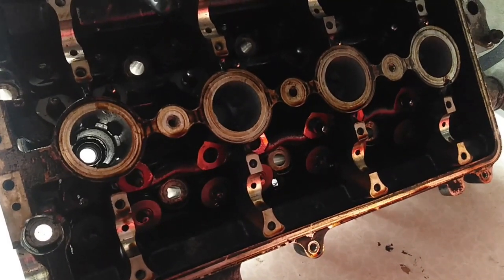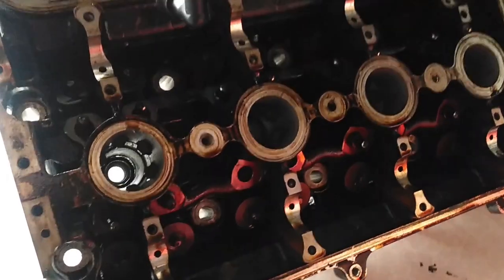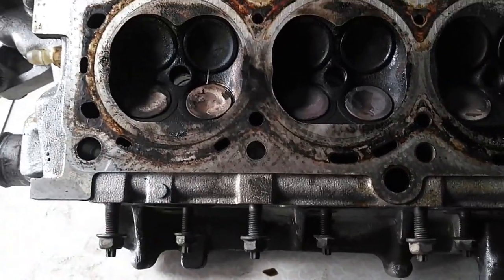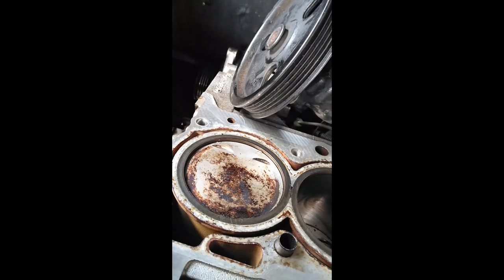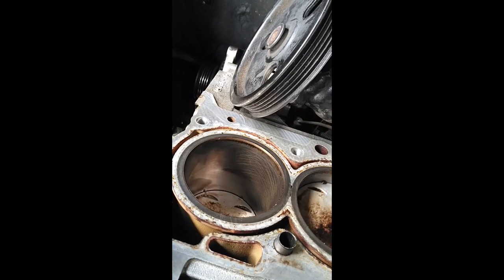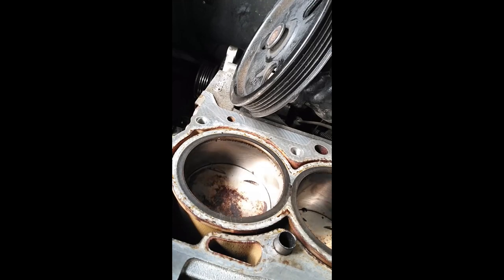Good news is I think we're gonna be okay. The old head gasket had that totally decrepit and rotted-out look basically to it. The head itself — the cams didn't look brightly polished. I think we're gonna be okay. These valves — I'm probably just gonna leave them in the car. I'll clean them up of course, but just hoping they'll have decent seats at a hundred thousand miles. This isn't three hundred thousand miles. Alright, let's hand turn this over through a few rotations, make sure there ain't nothing stuck anywhere or pissed off. Oh that turned easy!